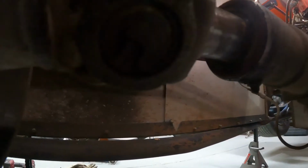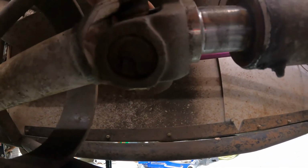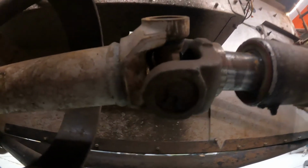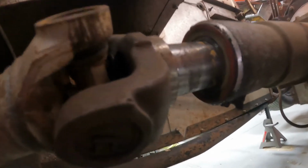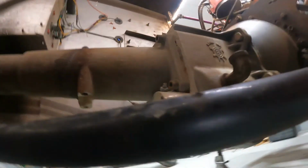Oh dang, yeah. So I usually run a seal or an O-ring around my driveline here so I can see how far I've been traveling in and out, and I think that came off after this all got gutted. What happened is this rear end shifted forward so far that it blew out the seal on the backside here. And when it does that, it'll actually deadhead and slam up into the internals inside the transmission, or the end of the housing, and push up on this transmission.